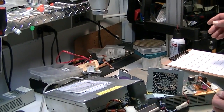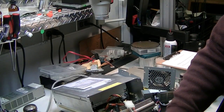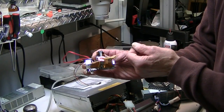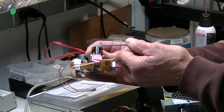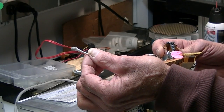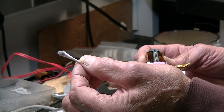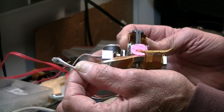If you have debris inside your tape drive or on the head of the tape drive, you can't get it off with a cleaning tape. Here's what a head looks like out of an LTO drive. Within this one-half-inch spacing — the size of the tape — you have 14 tracks and a number of servo tracks that position the head. This is a pretty typical example of the debris that we find on the head, and we've seen it a lot worse than this. Once the servo tracks are clogged up with debris, the head can't move up and down and read it.